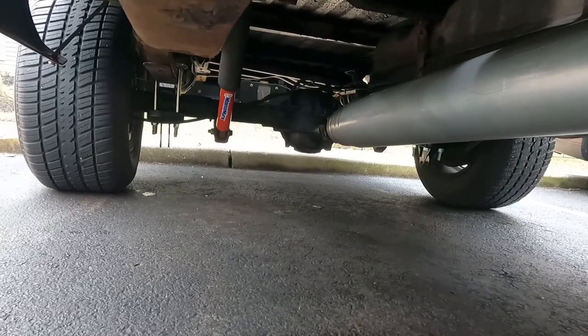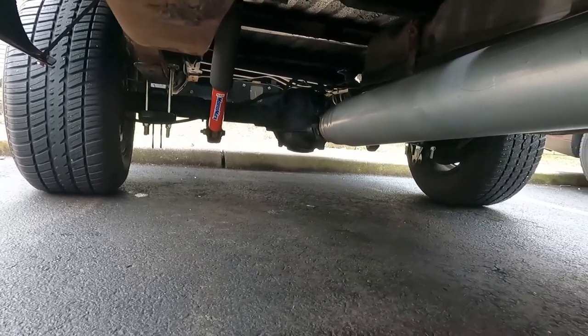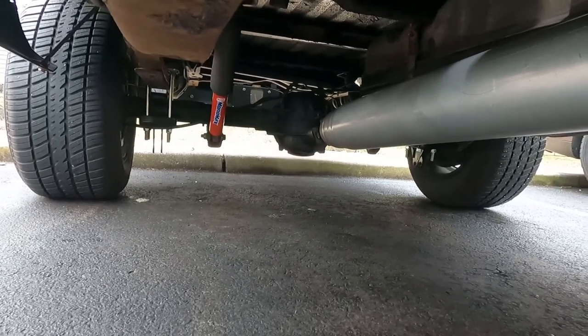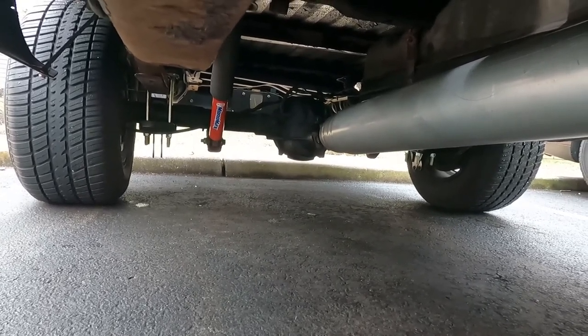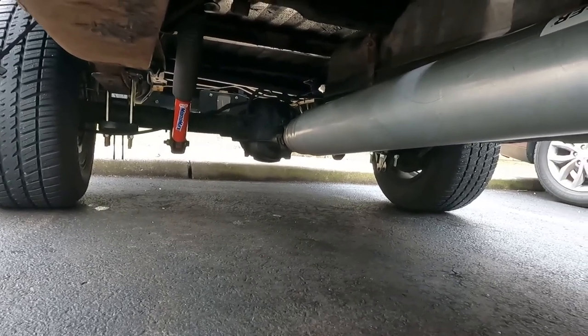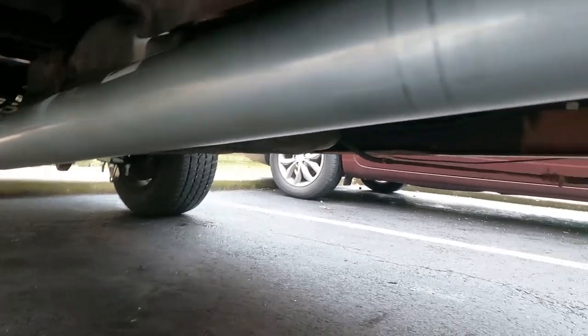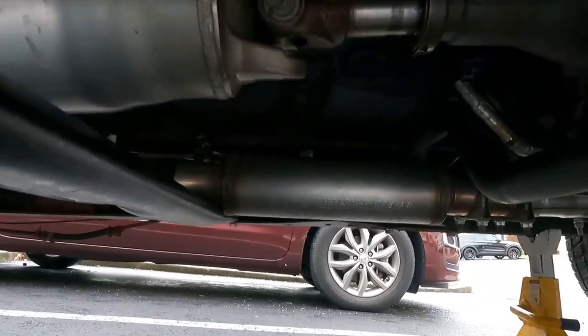So worked out fantastic. So anyway, now the pinion angle in the rear, the snout is up about 2.3 degrees. The angle of the shaft is about 1.3, something like that. So that's all good so far. My issue is the actual transmission itself.